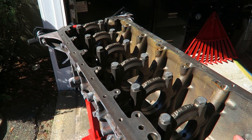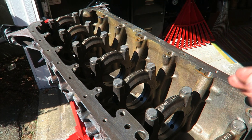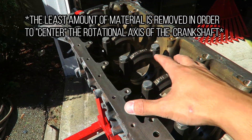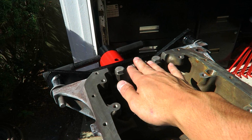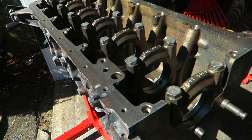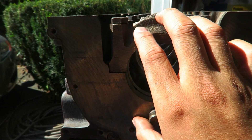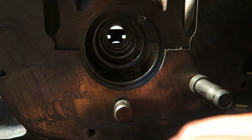The next thing done to this motor was a line bore. With 170,000 miles on it, if you're going to take it apart, you might as well do the line bore just to be safe. A line bore is essentially one big bore through all seven of these main caps, so that when the crankshaft is placed in with new or correctly sized bearings, the crankshaft is perfectly centered in all the main cap bearings. When it rotates, there's no imbalance or anything that could cause it to rotate erratically. Once the caps are lined up again, you can't even feel that ridge with your fingernail — small differences like this make a huge difference in performance once everything is running.